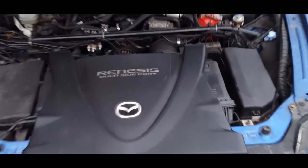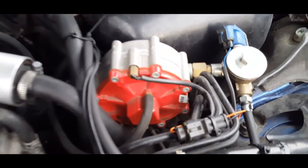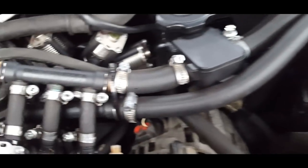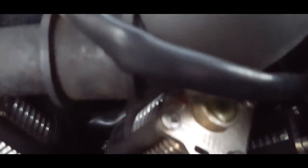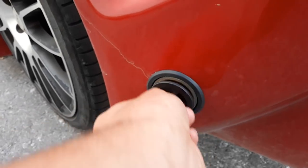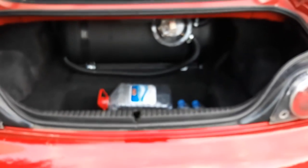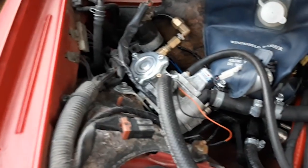Let's start with the hard questions. How much does an LPG conversion cost? The cost ranges from 1,000 to 3,000 euros, or 1,100 to 3,300 dollars. How long does an LPG install take? Conversions take about 2 days or more — anything less is not good, as you have to drive the car on the road to tune it properly.